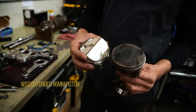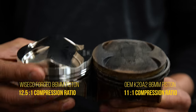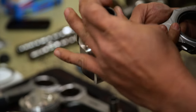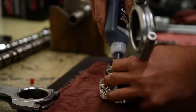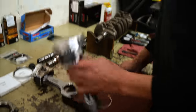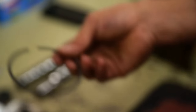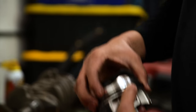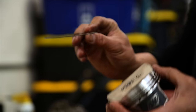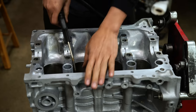There's your stock piston versus the aftermarket domed piston. Here we have the oil expander that goes on first, then oil rails one on top and one on the bottom, then the compression ring — this is what scrapes the oil down from the sleeve back to the bottom and keeps it from coming out. That ring holds the power. The hard part is done — all the measuring, specs, and cleaning — so now it's just the easy part: assembly.